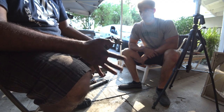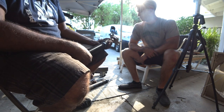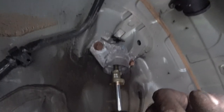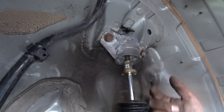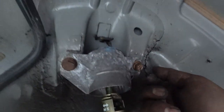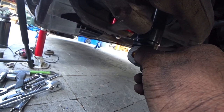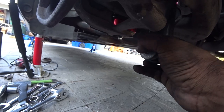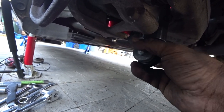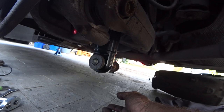Once the whole air suspension is completely done and we air out, we have to adjust accordingly until the desired height is set. Make sure you guys have the two 16 millimeter bolts in here. The way we got the shock in here is by compressing it against the wall and angling it in, then just hand-tighten the 16s. Down below, remember to use the washer on the inside — not outside — and the bolts across just like that. Then compress the shock, get it in there, and tighten everything down to spec.